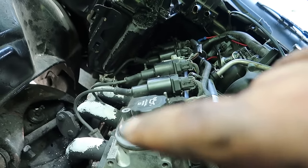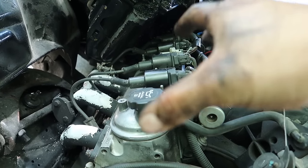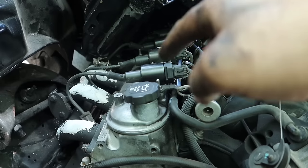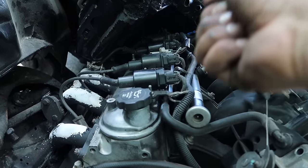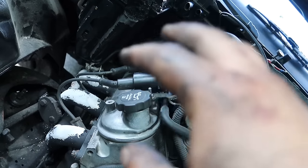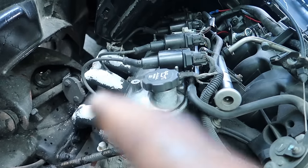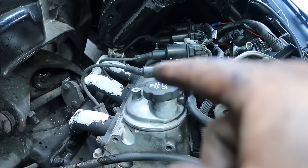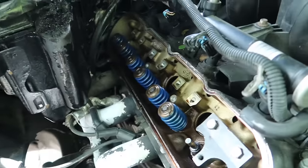I'm going to go ahead and remove the coil pack brackets - all the coil packs are on one big bracket and come off together. Valve cover is eight-millimeter bolts, rocker arms are eight millimeters and can all be lifted off on the pedestal. Then remove the push rods and keep them in the same order that you removed them. I'm going to cut down to the valve springs because the rest is simple enough.